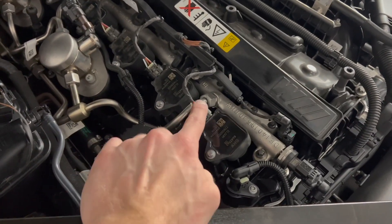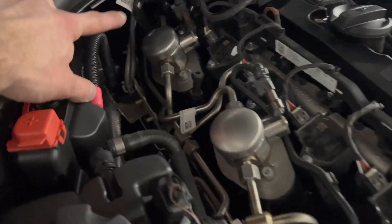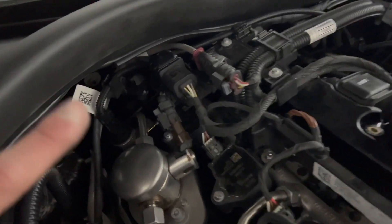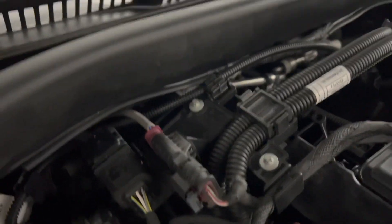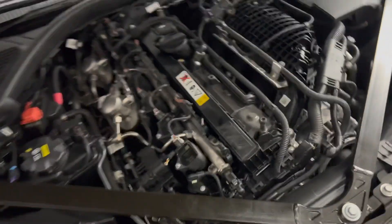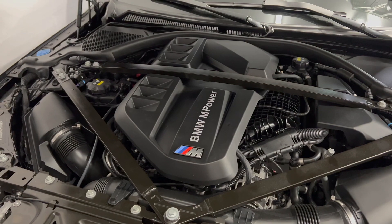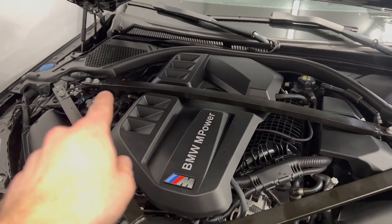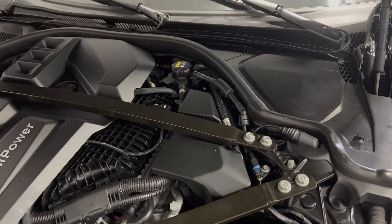The coils are tightened down and clips are pushed in. Be sure to plug in anything you unplugged, like the fuel pumps or the sensor back there. Got the O2 sensors back in the clip and the bolts back in. Put the engine cover back on, then the brace — tighten these bolts down to 28 newton meters — and we're done.